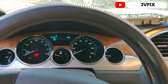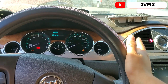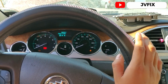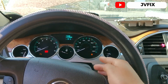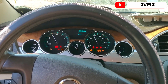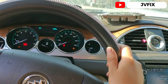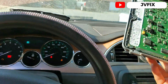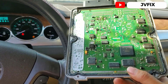We're going to program a replacement computer — they brought a used one. The problem with newer cars is you cannot simply reprogram a computer that's already been programmed to another car. If you get a computer from a different car and try to program the anti-theft on this car, it won't work because the PIN number is locked to that computer. What you can do is clone it, but since I don't have the right tool, you can take it somewhere else — there are many places online that offer that procedure.